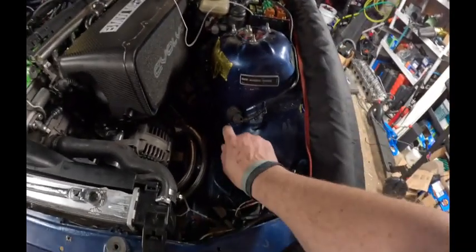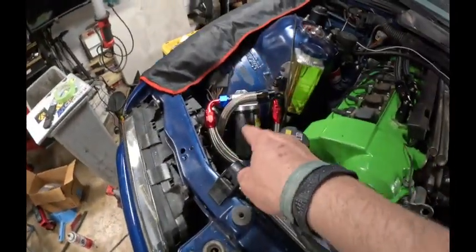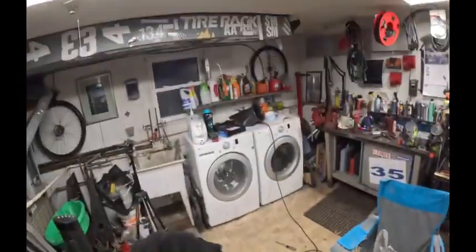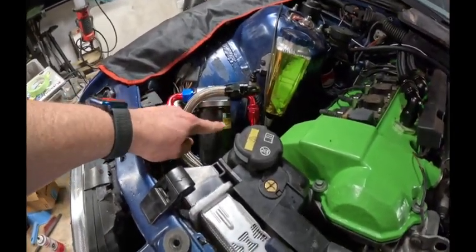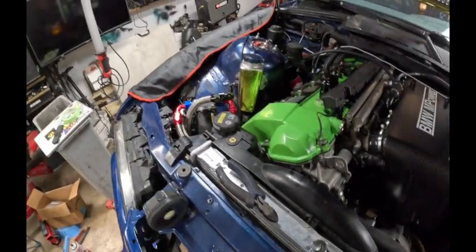There's no more oil filter housing — we have new AN lines now that are going to go all the way along the front of the motor to right there, which then loop down and around to the oil cooler. With the other half of the air box it didn't quite fit, but this actually works nicer because before my oil filter was a shorty Motorcraft one — now I can run a deeper filter, and more oil filtering is always better.